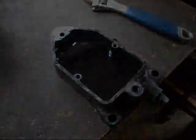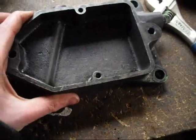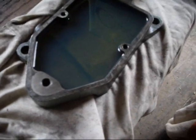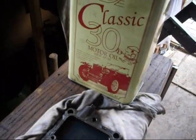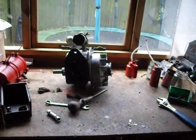I'm just going to wash this out with paraffin and then refill it. Good as new now. All I did was drain the oil out, put a bit of paraffin in, drain that, then wipe it around with a rag - it comes up really clean and gets all the dirt out. Some fresh oil in it now and you can actually see the bottom of the sump. What I've used is this Comma Classic SAE 30 non-detergent oil, which is perfect for these sort of engines. Hopefully that'll see it running for a long time and hopefully stop it smoking a bit. I think the problem was the old oil was so thin it was getting up past the rings.